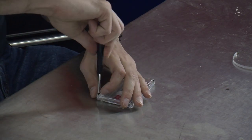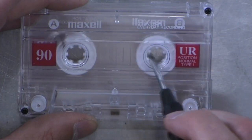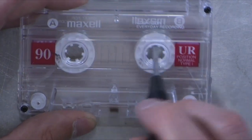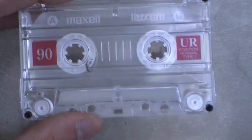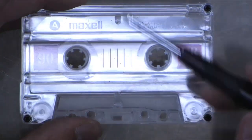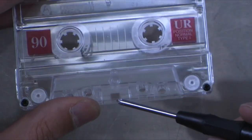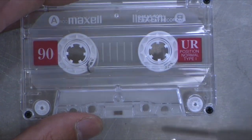So now we know all the basic parts of a cassette. This will actually still work and play — you won't hear anything because it's just leader tape — but there's all your basic parts: supply reel, take-up reel, slip plates, outer case, pressure pad, shielding, capstan hole, and guide rollers.